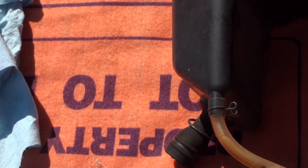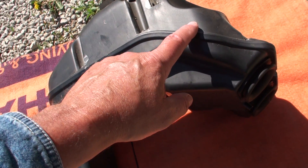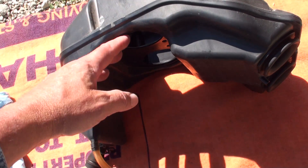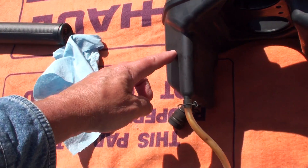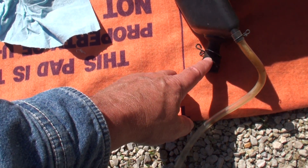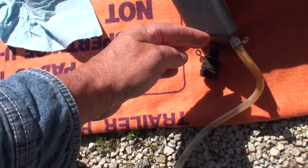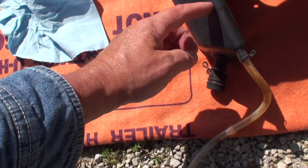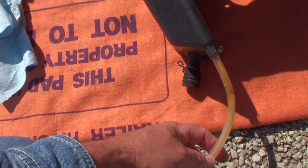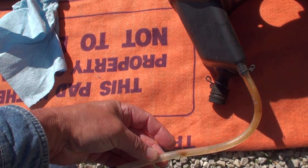So here's your air box. There's your line. Here's your intake over here — the air comes up and comes over, your filter's right here, and it comes in. But if you get any water into the back, this is your vent that goes down into the transmission. It's pretty much on the same level back here, so if there's any water that gets into the back, it'll definitely go right down into the transmission and also collect in there.